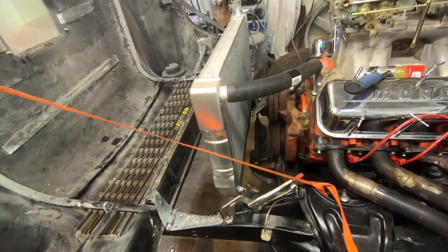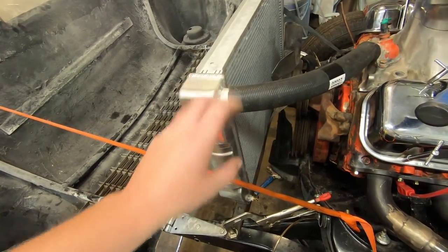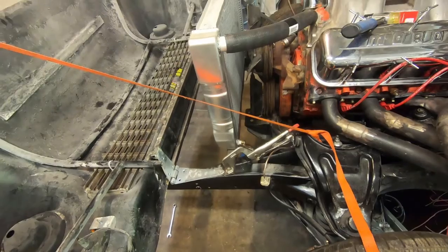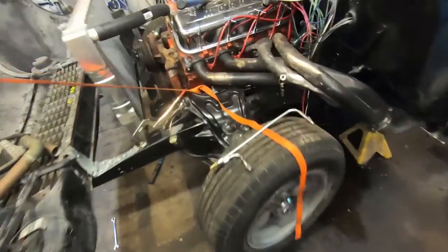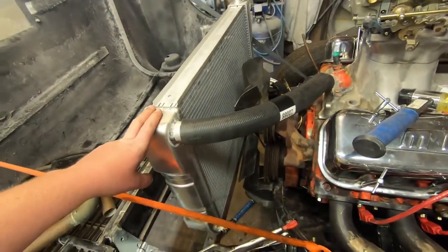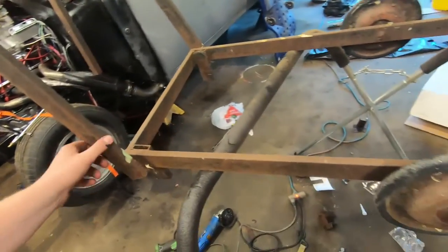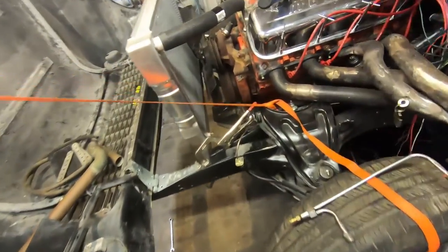I've got to put some sort of bracket up the side and clamp it on the top somehow. It has to be fairly strong. I'm thinking I want the limiting straps to go to the radiator and its whole mount, and I might have to brace it back to the frame. My old man had this old cart he had no use for - it's got some rectangular tubing - so I think I'm gonna use that to build something up the side of the radiator and triangulate it back down to the frame.